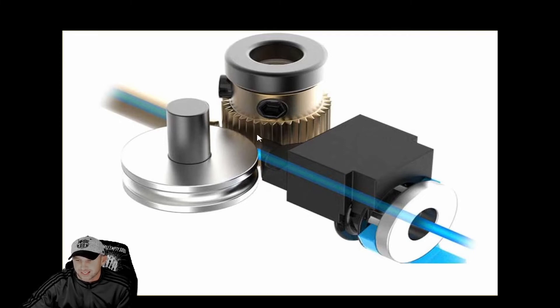You'll see here the gear has very good teeth still left on it and the roller is still in really good shape. In a lot of these extruders — this one doesn't show it — but you'll see in some of the other pictures that there are bearings in here, and those bearings can also get dirt, dust, and debris in them, so those are good to replace as well.